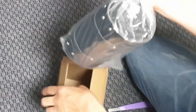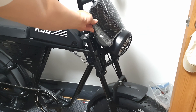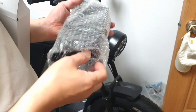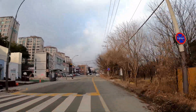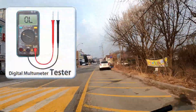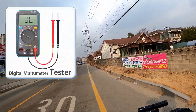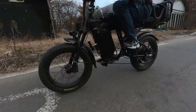Accessories include a bag and aluminum pedals. It even comes with a cool windshield. It also provides a charger faster than the typical 2A output, at 3A. Checking the charger voltage is indeed a crucial inspection point. The fully charged voltage for a 48V battery pack is 54.6V. When tested with a multi-tester, it's within the normal range, not exceeding 0.5V. Considering the price, the performance is excellent.